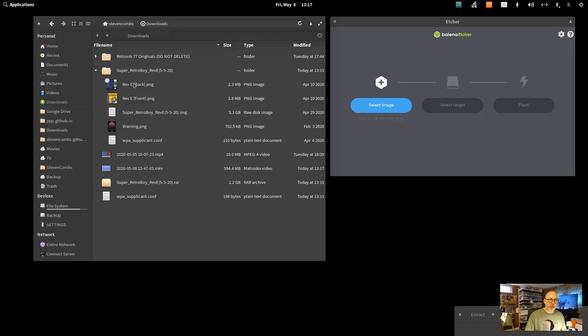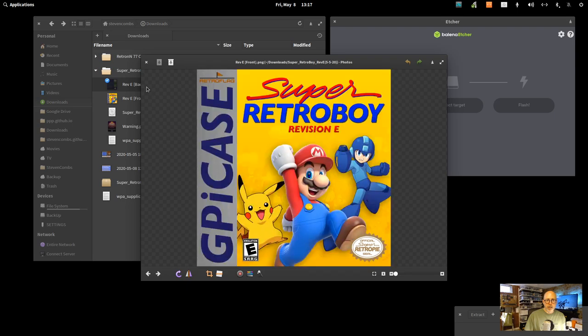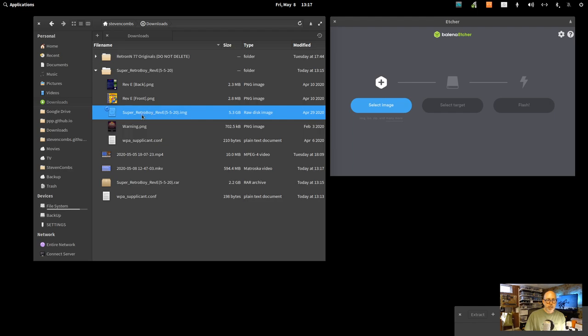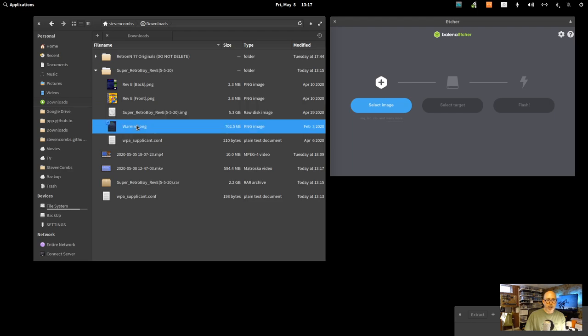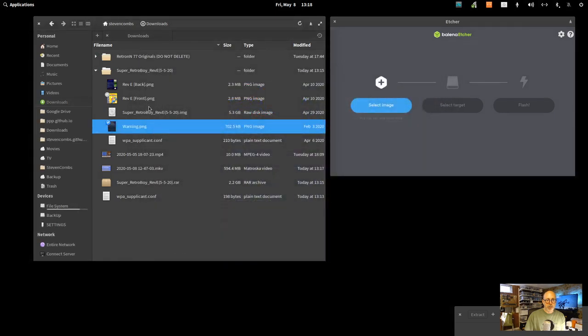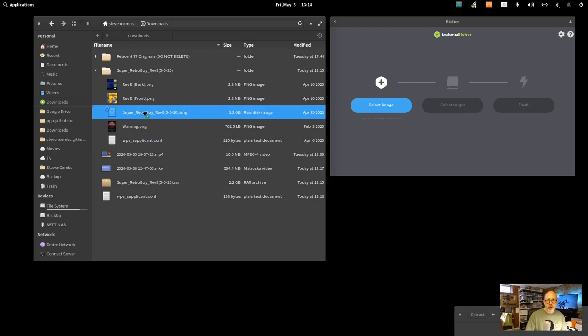So here's our, let's see what we have here. We have this image here. We have this one. This is all included in the package. Here is our actual image that we're going to burn. We have a warning. What's our warning? Our warning is, please keep in mind that we aim to offer a clean, stable, and efficient experience. Okay, well, thank you for the clean and efficient experience. This WPA supplicant conf is something that we have to do something with. We'll take a look at that in a minute. But now we should be able to come over here, drag this image file over, and there we go. We've got it. Now let's select our target.